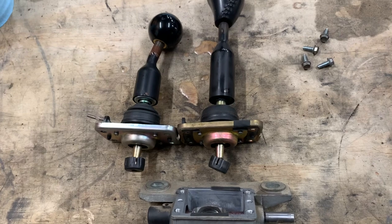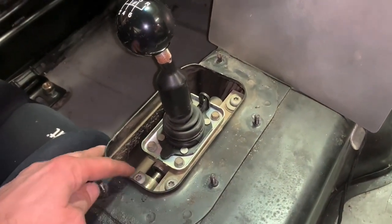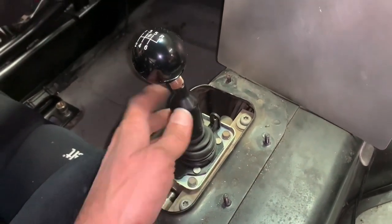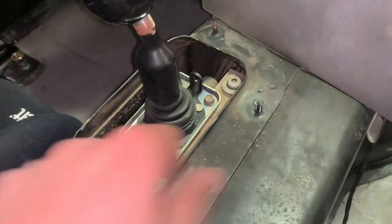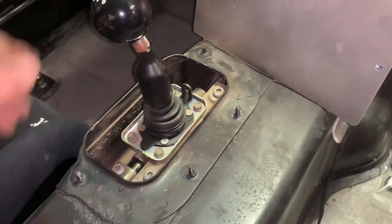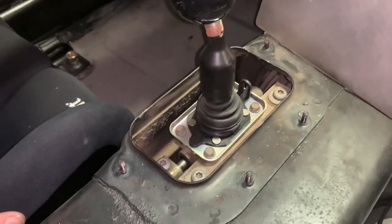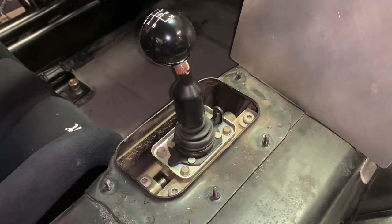This is about one of the easiest upgrades you can possibly do. Shifter's back in, everything's bolted down. Something to note: I used a little bit of blue loctite on all of these — just to keep them from backing out. That's the four that hold the shifter onto the box, then the two that hold the shifter in place, and the one that goes to the linkage. I've done a test run through all my gears to make sure everything's working okay, and it feels a lot more firm than it did before. The other one was a little floppy — it probably has to do with that bushing being worn.